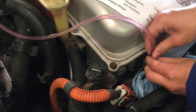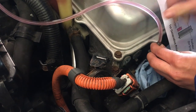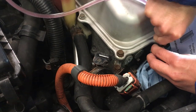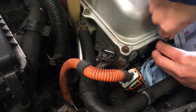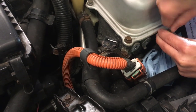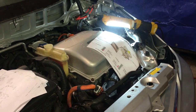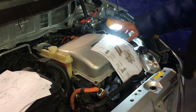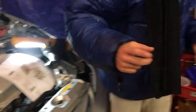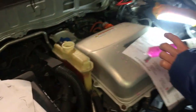After we take this off we're going to tighten it, but we'll do that off camera. We'll finagle this hose off — it takes decent strength because the hose was widened. Now we're going to let it seep out and take this out. We'll probably wipe down the inverter after. Then we're going to add some coolant using our syringe injector and shine a light to check the level.